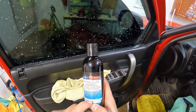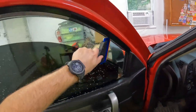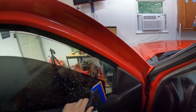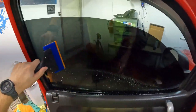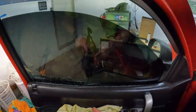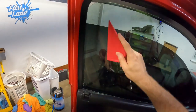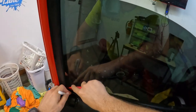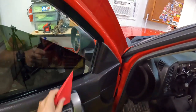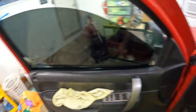Do not use on dry glass or transparent plastics, and also don't let it dry. If you let it dry on the glass, I honestly don't know exactly what would happen, but if you went around and did all the windows at once and left it sit, you'll come back and it may be starting to dry — when you wipe it off you'll notice a residue. What I'm going to do is, same as any other window after wiping with the towel, go ahead and hit it with a squeegee mainly to get my edges. Now we're ready to install.